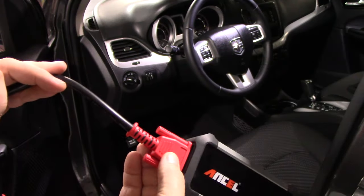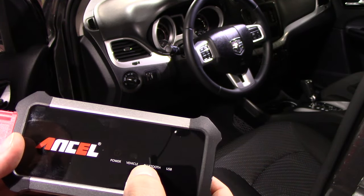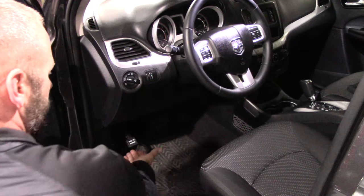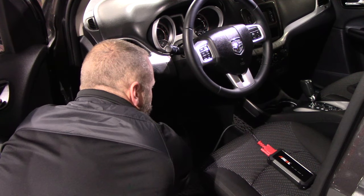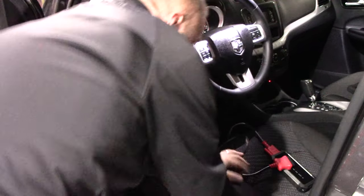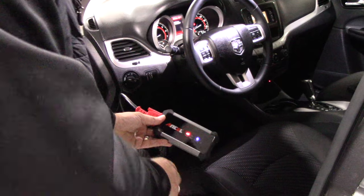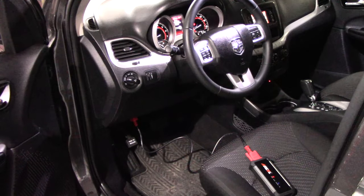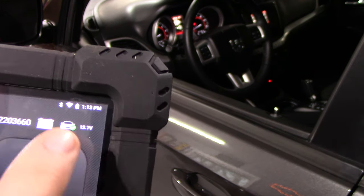To connect, you plug your cable into the OBD2 port. On the dongle you'll have your power indicator, vehicle indicator — which lights up when it's talking to the computer — Bluetooth indicator, and USB if connected. The OBD2 connector location varies by car; this one's right above the emergency brake. Turn the ignition on first, then plug it in. It beeped — we have power, we have Bluetooth, and the vehicle is talking to it. The screen shows a green check mark confirming you're connected.